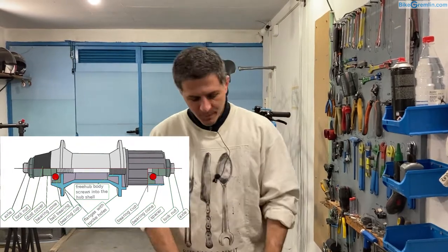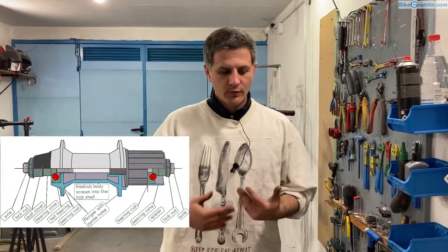Before we start, when you're servicing a cup and cone hub — why would you do that? Those hubs require regular service maintenance about once a year or every 5,000 kilometers, just over 3,000 miles for those not familiar with the metric system. Depending on your riding conditions you might want a more frequent schedule, but a safe bet in my experience is once a year or 5,000 kilometers, even if you ride in dirty, muddy, or sandy conditions.